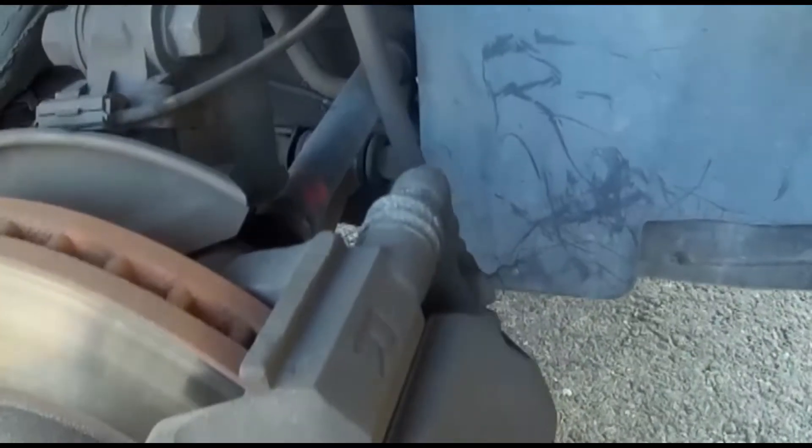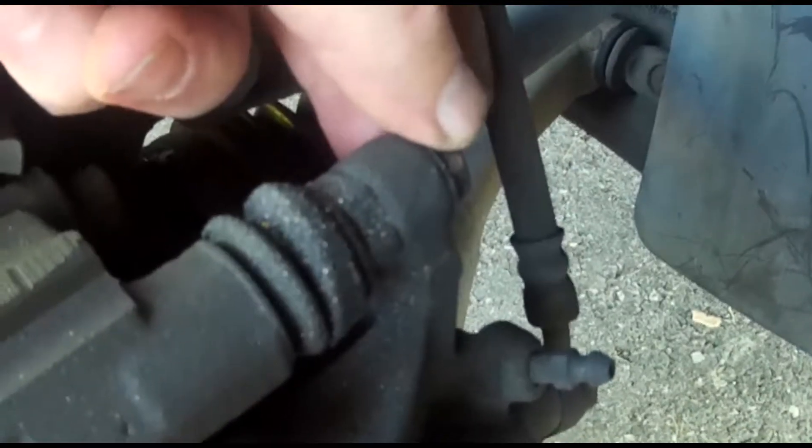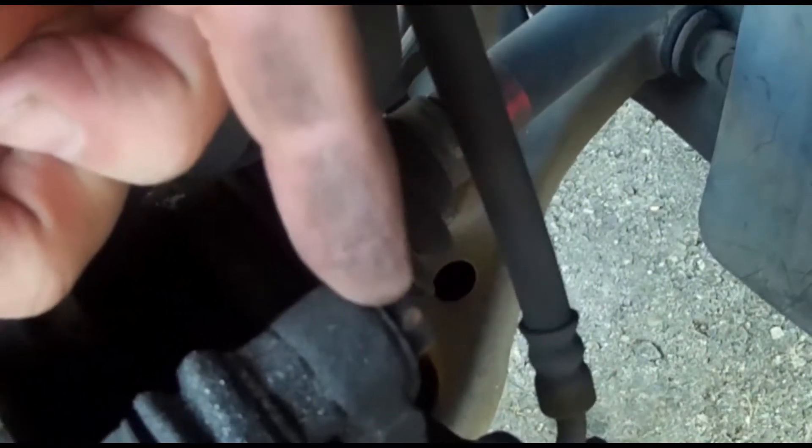The real problem right now is on the back of the brake caliper. The guide pins that hold the pads in place have been removed so many times that the heads have worn round, and my hex wrenches are not able to grab hold of them.